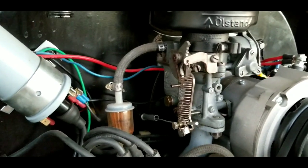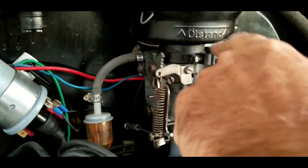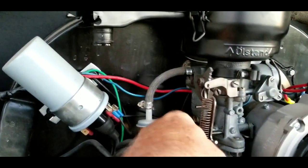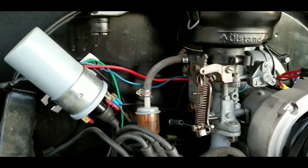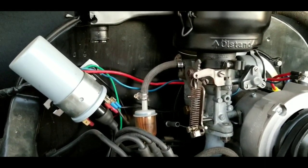But this particular one right here — no. Instead of the air coming in through here, a little tiny bit is coming in through here when the throttle's open, and it's just such a minor amount that it will not change your mixture.